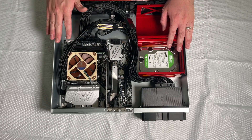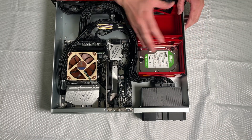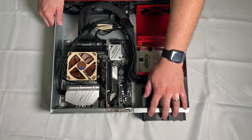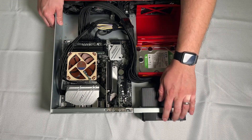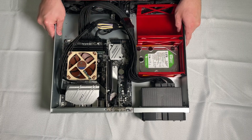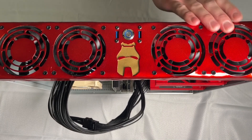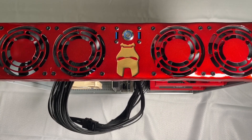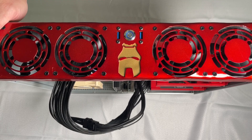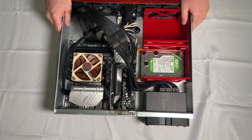All the files for everything I did here are available on my GitHub. These should work in any 2U case as long as you have space for them — you could just print these out and have configurations of three hard drives in a 2U case. The ATX-to-SFX adapter is configured for the ATX standard, so it should work on most cases if you want your SFX power supply to stick out the back a little bit, which really does free up a lot of space inside a small server chassis. I've also included the DXF file for the laser-cut front plate, though that's only going to work with this specific case — you may need to modify it for a different case if you want your own custom Iron Man front plate.